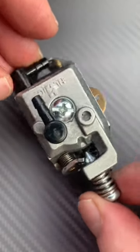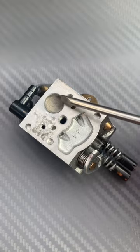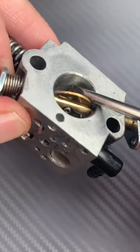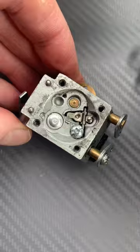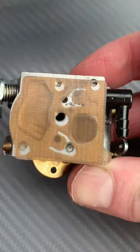There can be many reasons why a carburetor malfunctions. There are tiny little fuel holes that can get blocked, usually a screen filter that can get blocked. There's the main jet and the low jet holes. There's the adjuster screw holes that can get dirty and block. There's the metering system and its diaphragm that can malfunction, and there's also the fuel pump diaphragm that can malfunction.